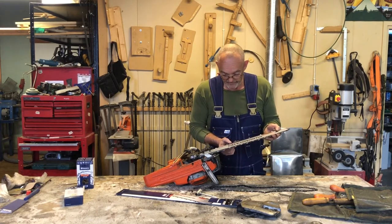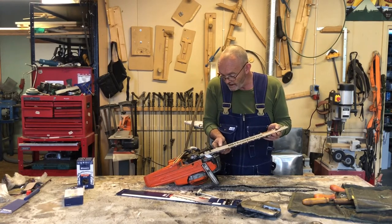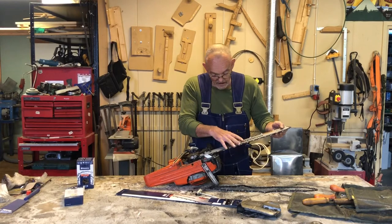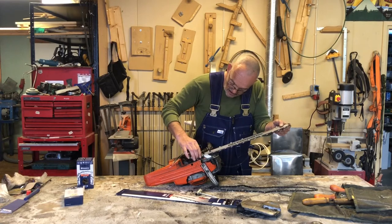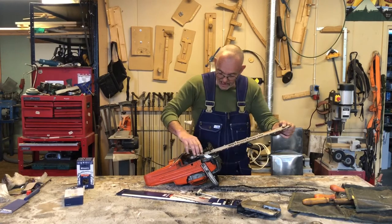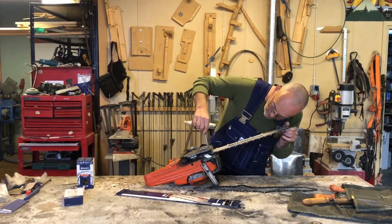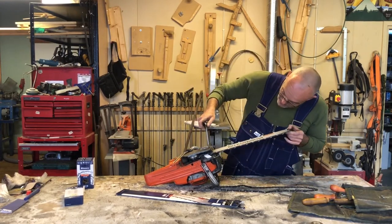So I think I didn't do a video yesterday. In fact, I haven't done a video in a few days now. Although I've been doing some filming, I've got nothing complete because I've been doing little bits and pieces. And I was back on the big tree felling job, and what a nightmare I had with that chain and bar. I just sharpened the chain and I'm thinking, well, it can't be that, because I've just done that. And turns out it was the bar.